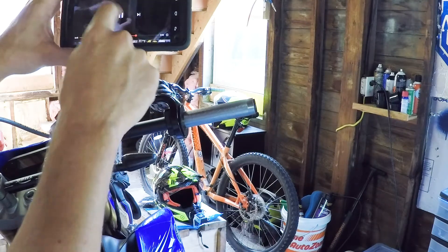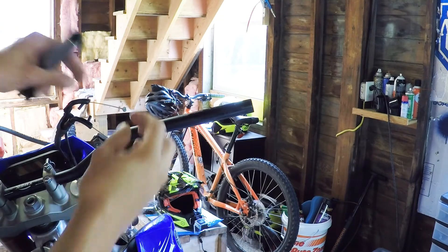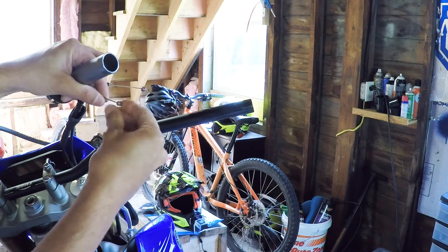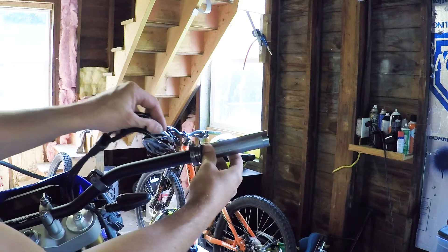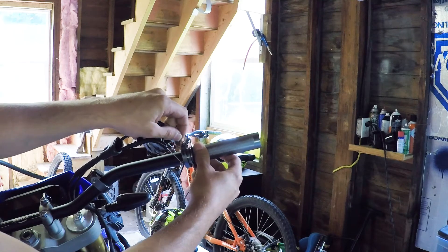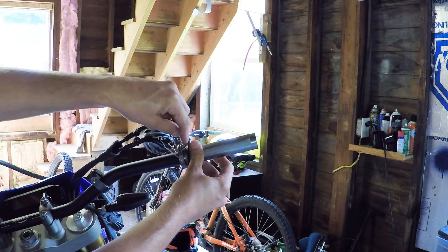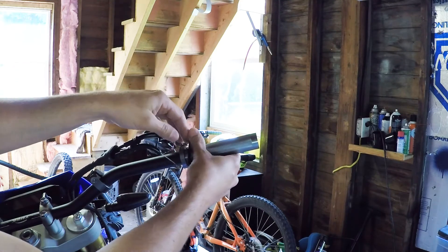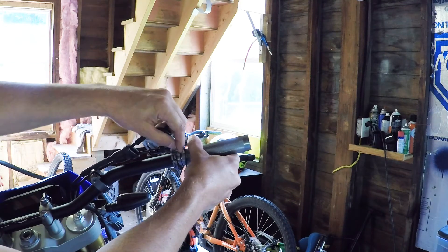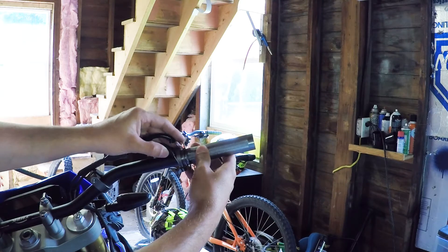Let's try this — going to put a little grease on the bar, some grease on the ball things, into the cable. Grease them up just like before. Decelerator cable first — pop that in. It's this first hole — decelerator cable first, then push it forward, turn it forward. Then accelerator cable second, and then we're golden.